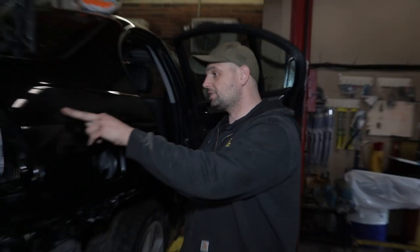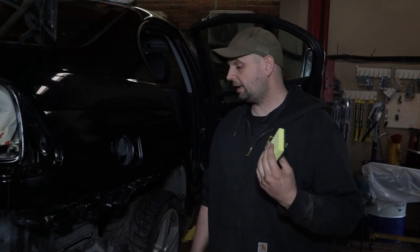The paint has dried, the clear coat has dried, and because the roof in this building is absolute garbage, something has dripped all over the clear coat and left these nice streaks throughout it. So we are now on to the wet sanding portion, which I'm going to hope will get this gunk out of the paint. So we're gonna get this panel sprayed down, get the sandpaper, get the sanding, and hopefully this will turn out well. But we'll see.